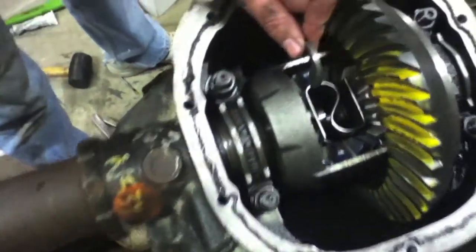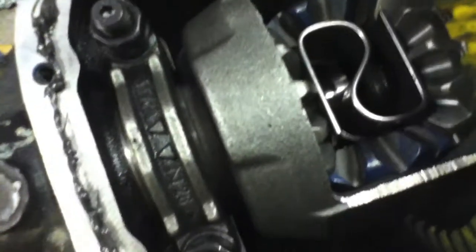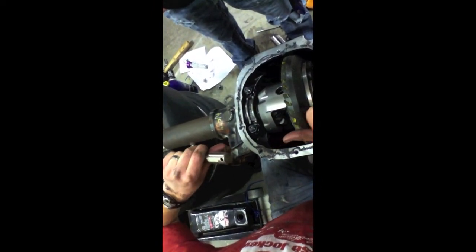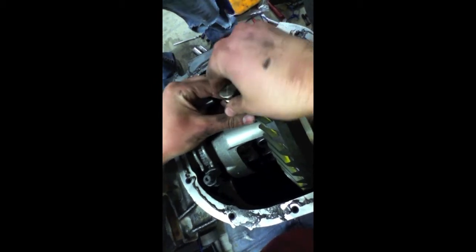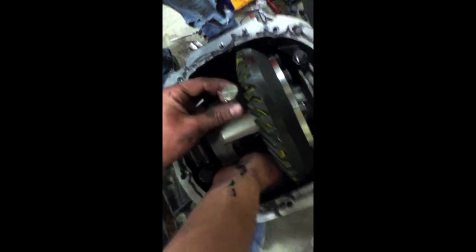So we can move this axle shaft back and forth and you can see where the axle is coming in. You just put the C-clip right there where it's completely on and get it with both fingers. Alright, so the axles are in, we put on the C-clips, and then we pulled the axles out just barely until the C-clips disappeared into the housing. Now we're going to put our post in — it just slides right into place. Make sure that you do it with the screw hole on the outside and put your hand in there to catch it.